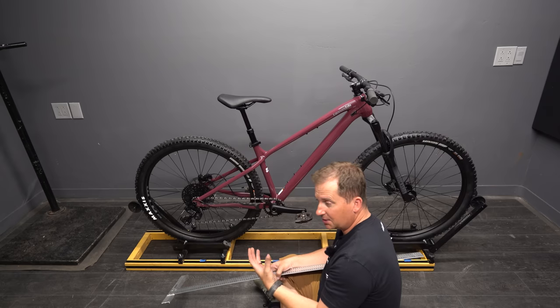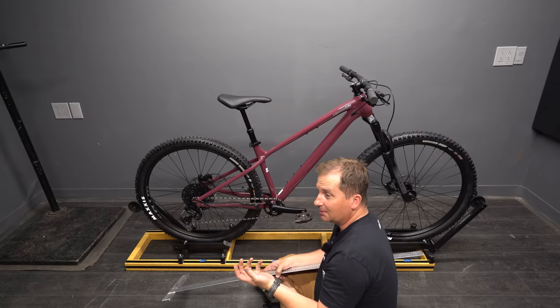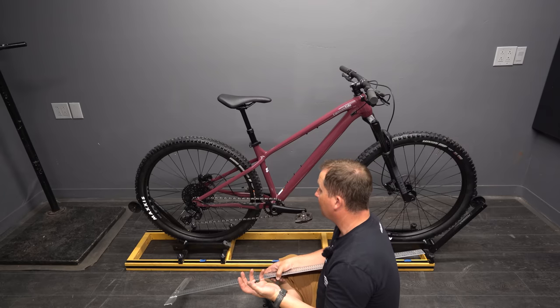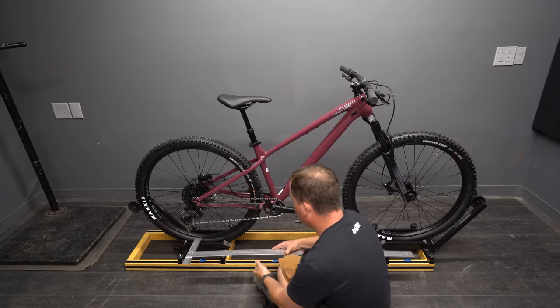A lot of bikes match the geo charts perfectly. A lot of them don't. And if you're shopping online and you've never thrown a leg over the bike, which is the case for most people these days, you need to know if the geo chart is accurate or not.